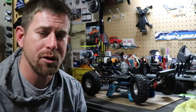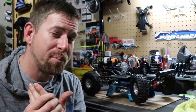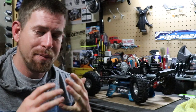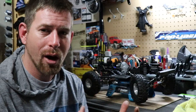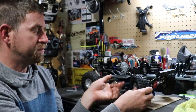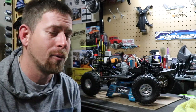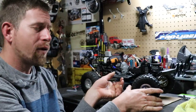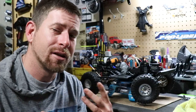I've been doing a little bit of an overhaul on the truck, changing up a few things and upgrading some parts. Then I ran into this major issue that's boggling my mind. When I'm turning right and left, sharp, at a regular good speed, the front end starts jumping, skipping, and hopping — kind of like it's getting bound up or seized up.